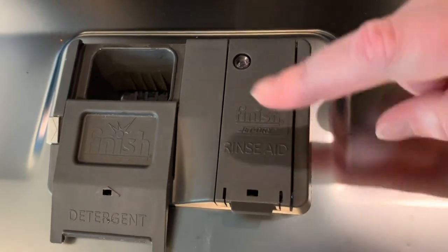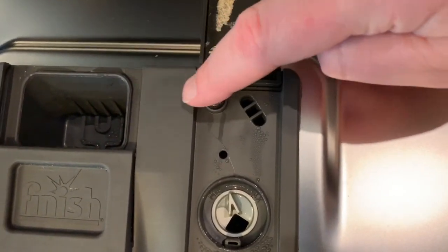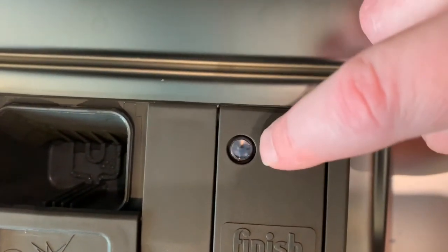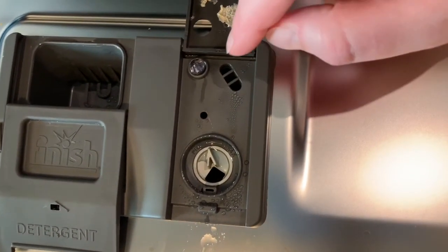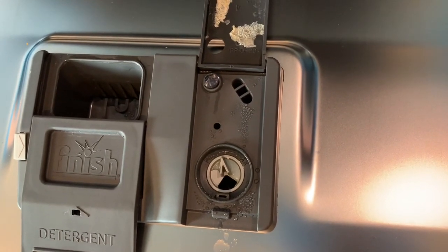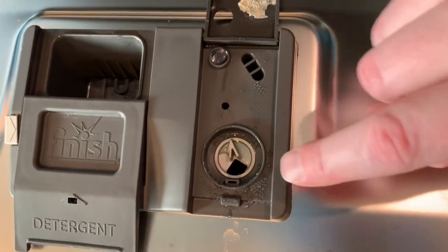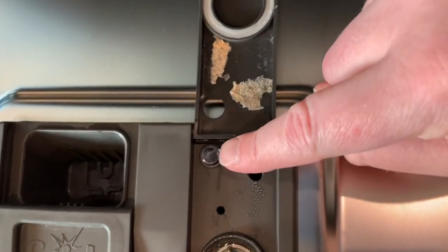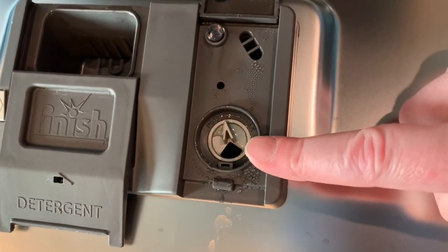Next thing is going to be your rinse aid. This is your rinse aid spot — I just open this up and here's what I see. See how it's silver at the bottom? That actually means that the reservoir is empty, so at some point I'm going to have to go ahead and fill this up. I personally like the OxiClean brand drying agent, but you can use JetDry or a couple different brands. Regardless of what you use, you fill it in this hole right here. It fills up into that reservoir, and when you see it fill up to the top, you're good.